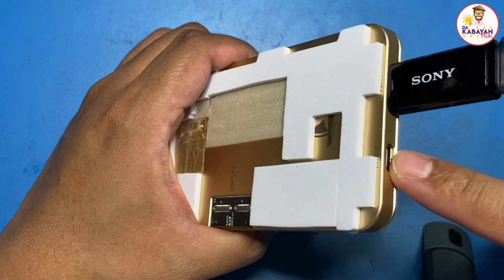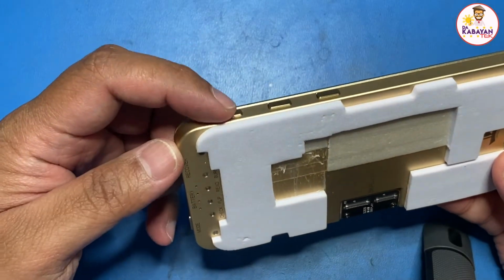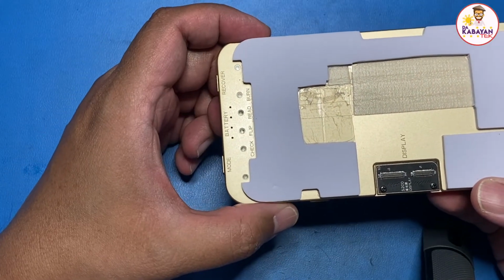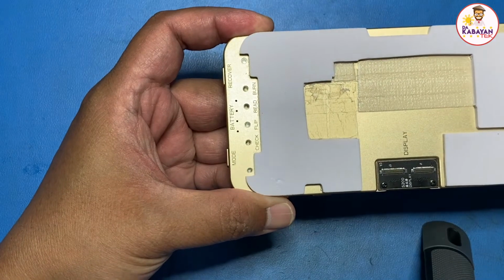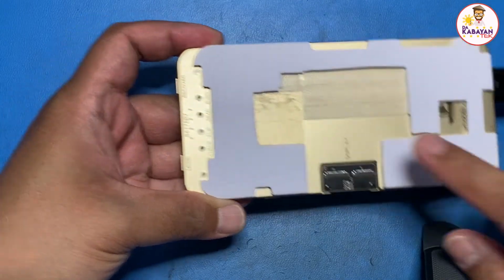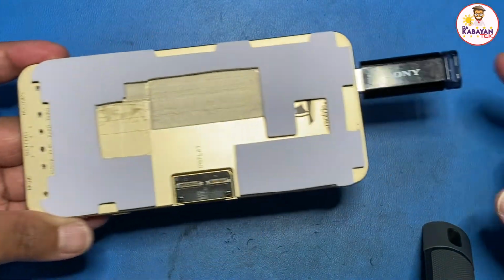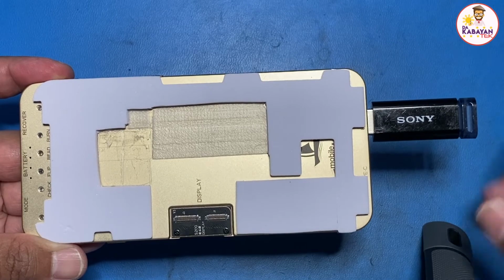Before I plug in the power, I'm going to press the power button here, which is on this part, and also the brightness button here, which is on the top part, because there are 2 buttons here. I press them at the same time. What will happen is the update LED here will blink, and once it blinks, it means the update is starting to get read from the USB stick. Then the check LED will also alternate blinking, and you will also see your USB being read. My USB here has a red LED, and it will show you that it's reading it.